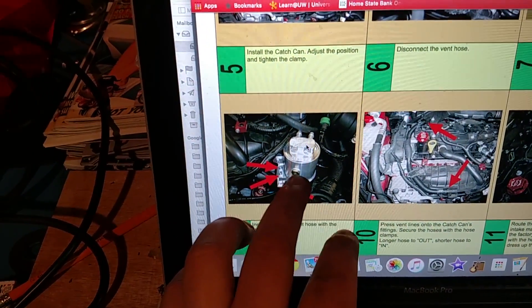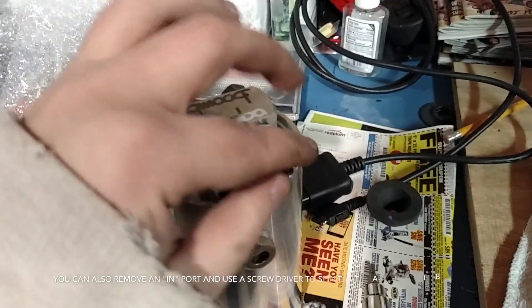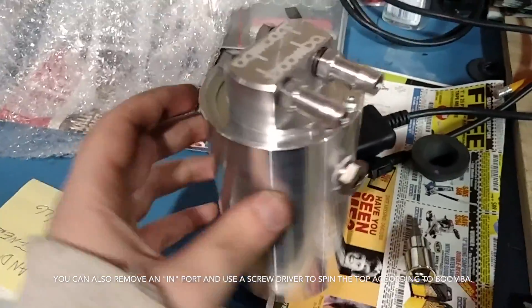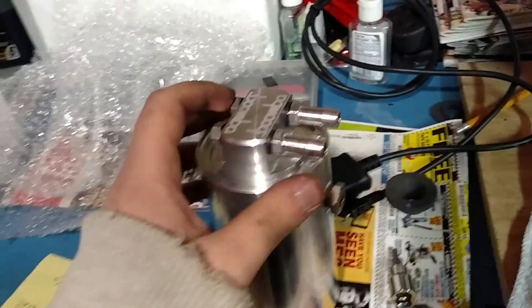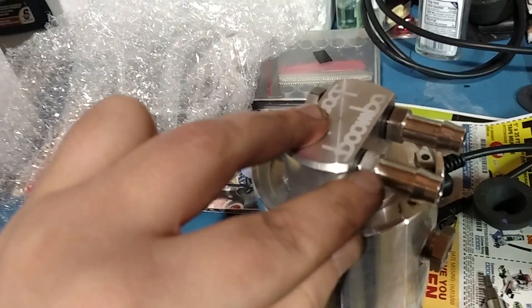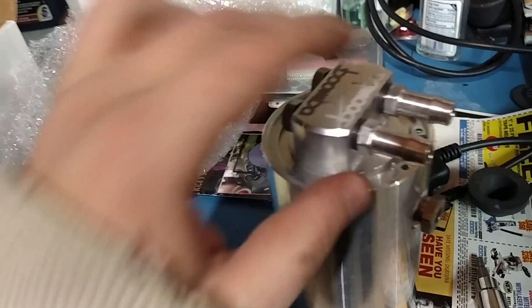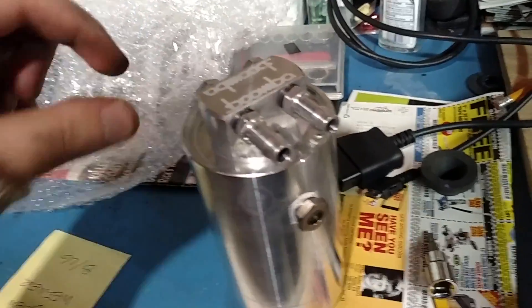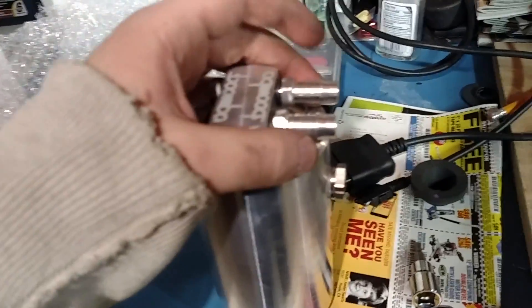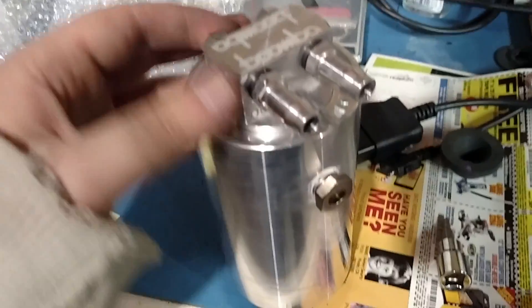In the instructions it shows the vent window and plugs facing towards the back, but on mine they came with the vent window and plugs facing forward, so what I'm gonna do is just switch sides. It's a 13mm socket to do these. You're gonna need pass-through tools to do this side. If you're not careful you're gonna mess them up a little bit, so make sure the wrench is seated all the way down at the base before moving, and have a stable platform. The other option would be to remove the hog ring and turn the physical piece around, but I don't have hog ring pliers.